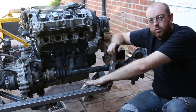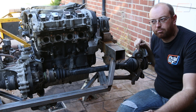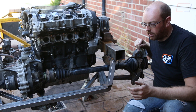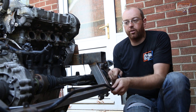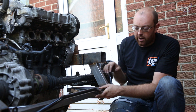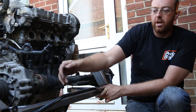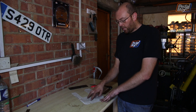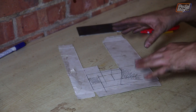You'd think we're now going to work on the upper radius arms, but we're not — mostly because we haven't got the parts yet. Instead we're going to work on the anti-roll bar, which also lets us close off the back of this section of chassis. With it bolted in approximately on both sides we can lift it up and see where it fits onto the back of the frame. If we put a plate-come-bracket across the back here, we can bolt the two original mountings directly onto it and the anti-roll bar actuates as normal. We've done a quick design with tabs at the top that fold around the existing cross member for additional rigidity fore and aft.